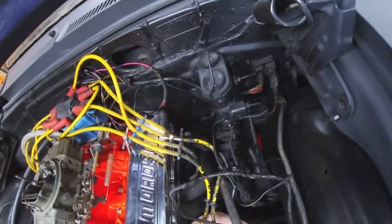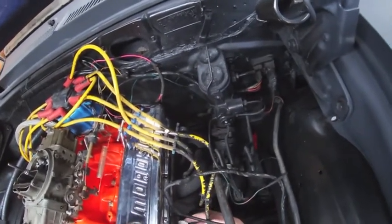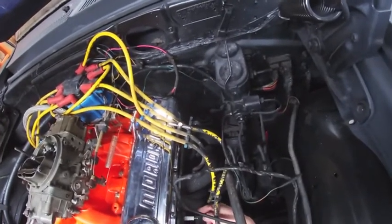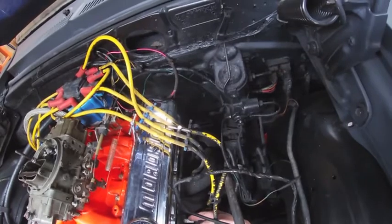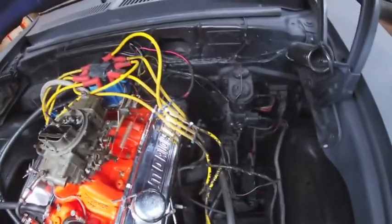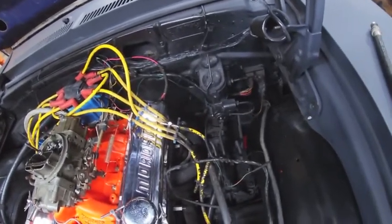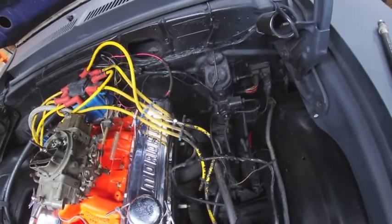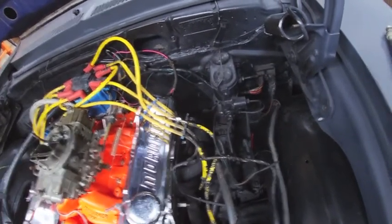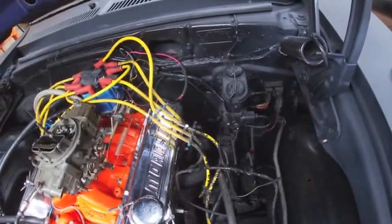Start by pulling plug number 3, and the reason I'm going to do that is I'm pretty certain it was this one here that originally, when we got this engine running and I pulled all the plugs to clean, number 3 had a bit of rust on the end of it. So I suspect, since this car had been parked for a while in a damp space, that there might be some rust in that cylinder, and it might be something going on with the valve itself, that maybe it's getting stuck open, or who knows. It just seems to me like the appropriate starting point.